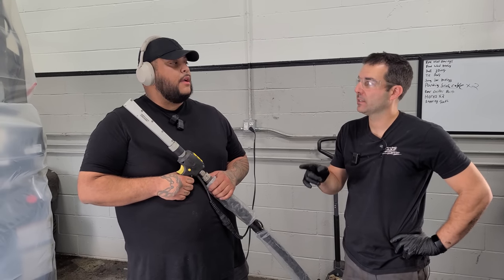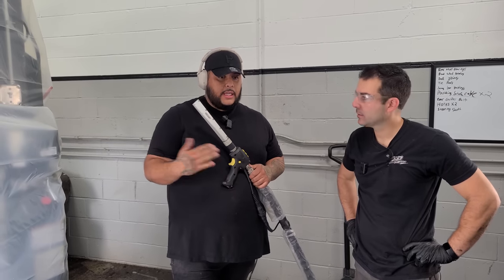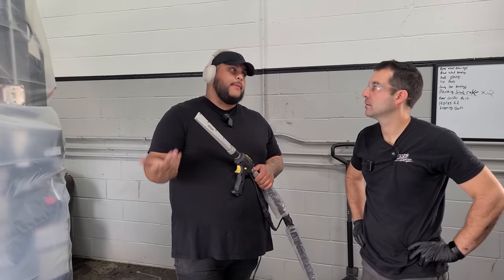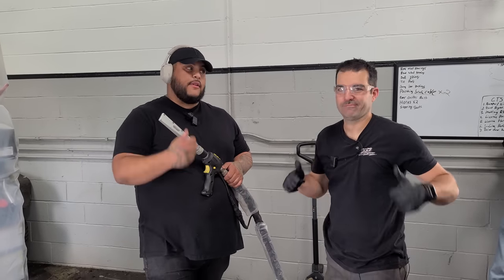The air compressor is set at 100 psi right now and we can go to 150 — it's 300 CFM. This machine won't eat that much of the CFM, but the more overhead you have, the better they work at peak efficiency. Even with little machines that need 30 or 40 CFM, if you hook them up to a big compressor they just blow through their stuff really well.